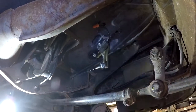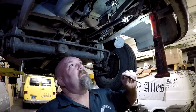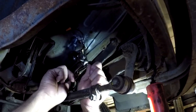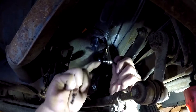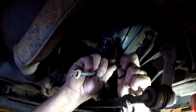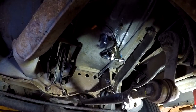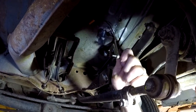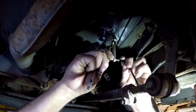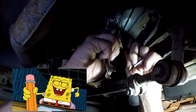We've got the aftermarket pivot assembly — it has an allen wrench bolt in it, which makes this totally different than the stock installation, but still fairly easy to do. We have to pull this allen bolt out because it's 6 millimeter and it's too big for the Max cable. It's got glue on it, it's a pin, and it's allen so the ratchet won't fit in here. Dear aftermarket part makers, please stop using allen heads.